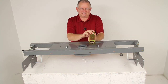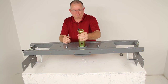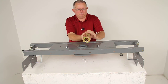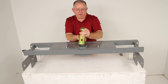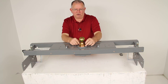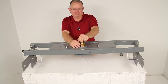This is a single-piece machined ball socket, providing rugged durability. It has a square ball base to prevent the ball from turning in the hitch during hookup — when you drop it in, being square, it will not rotate. The corners are chamfered on the square piece, so when you put the ball in either upright or stowing it, those openings at the corners allow dirt or grime that builds up to fall out so it doesn't prevent the ball from getting stuck.